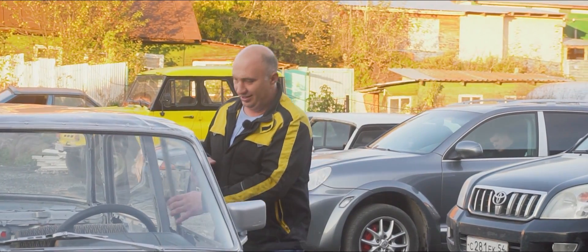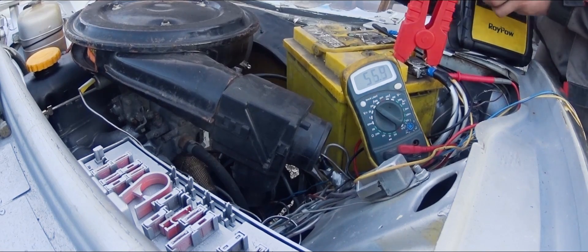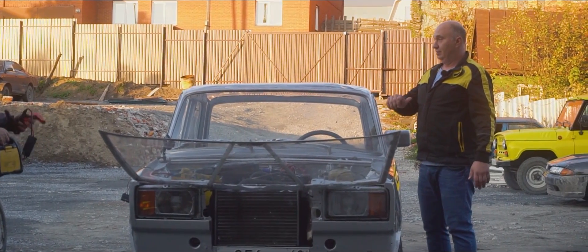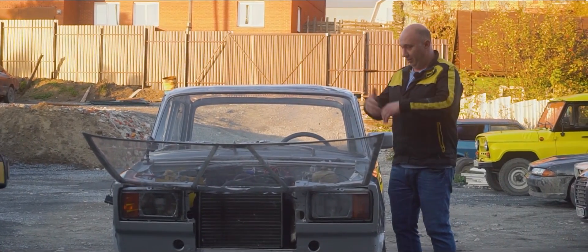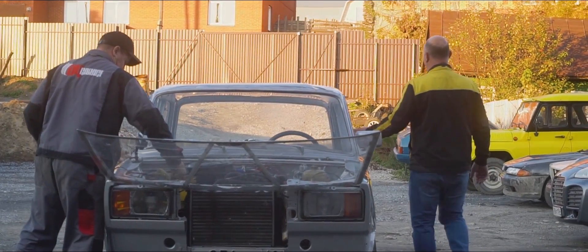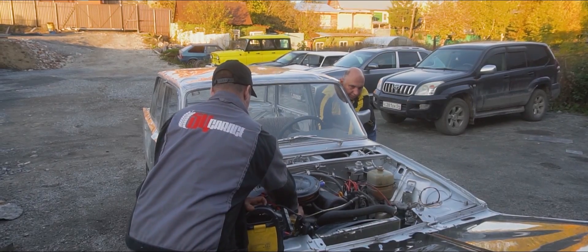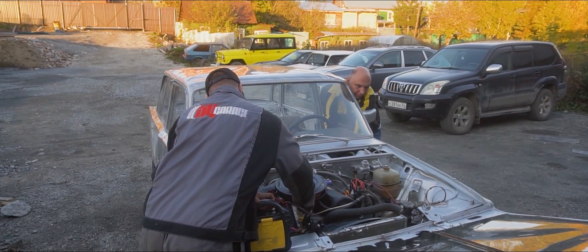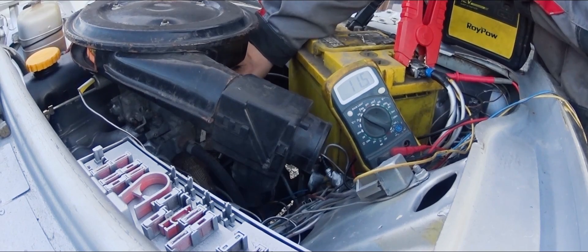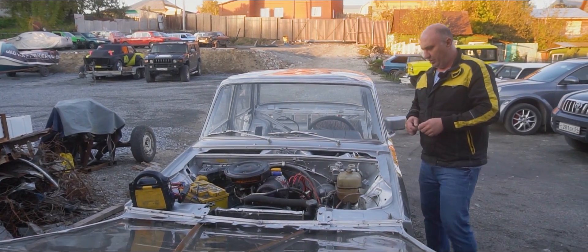And then we see what happens. It was running when I disconnected it — I flipped the switch, and suddenly it was over. I saw 56 volts and that was it. It went up to 56? Though I'm not buying that 56 volts was enough to kill the car. We had a look and we don't have spark. I'm guessing the switch died — or maybe it was the coil. Yeah, it was probably one of those.